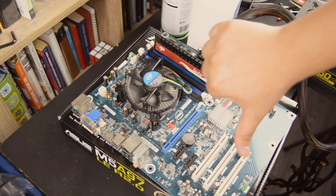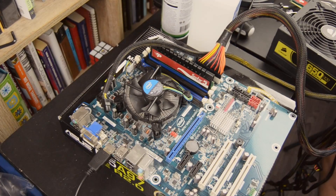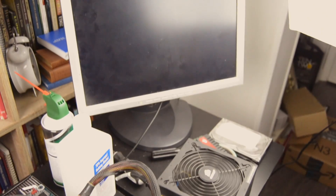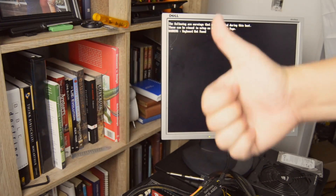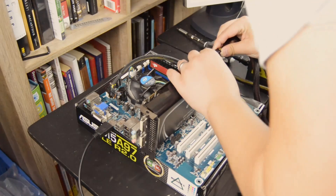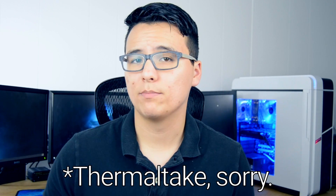After wrapping all that up, I reassembled the system minus the GPU. I noticed a bent capacitor on the motherboard, making it look even more like the motherboard was the issue. However, powering all the components with my spare power supply and jumpstarting the caseless PC with the screwdriver trick, I heard a beep — and then I saw the BIOS post screen. I plugged the GPU back in once more to confirm the whole system would work together, and again the computer posted. It turns out, after all, the culprit was his cheap, no-name power supply.